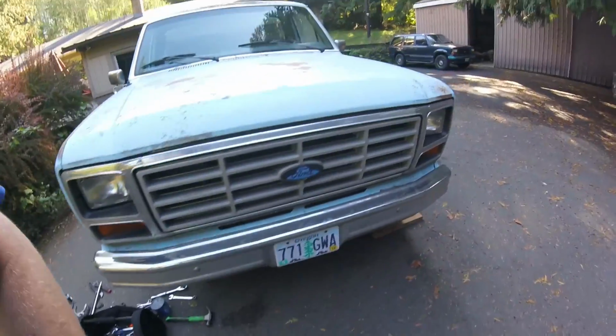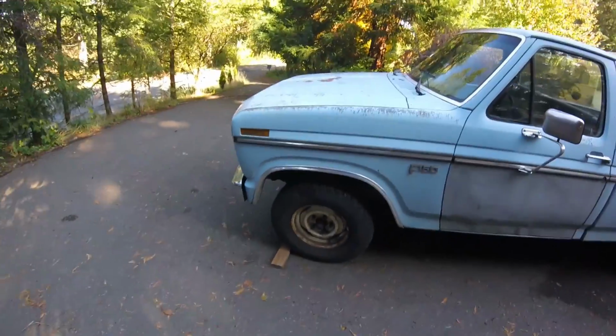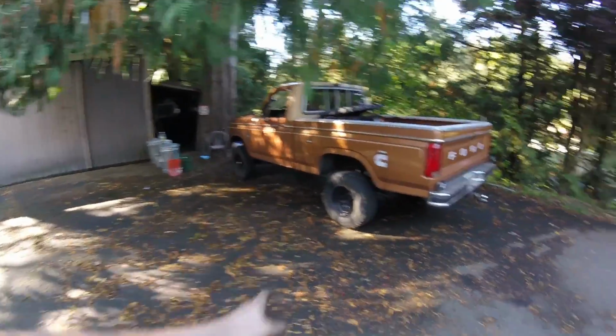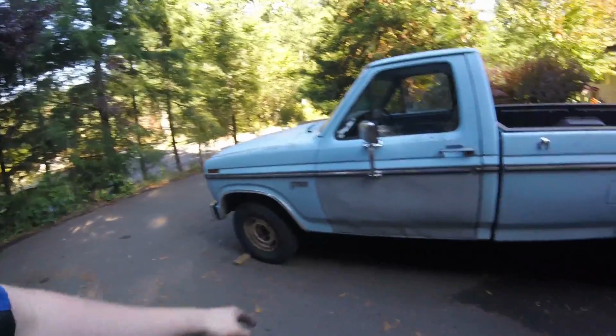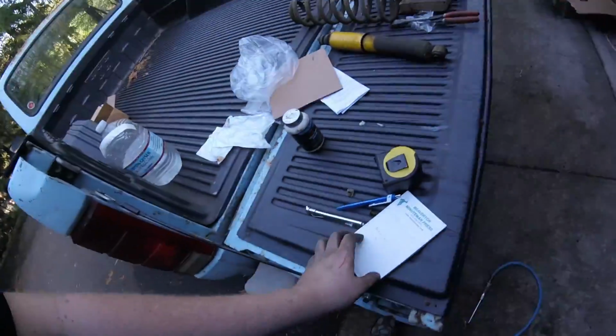I don't know how much the steering alignment is going to be affected as far as toe goes, because I don't know how much it's going to lift. Because when I put those springs in, I had the 4BT, and remember they came out of this truck, so it sat just about level, and then the wheels were all like this, and I jacked his up to where my truck used to sit, and they didn't camber out that much, which I thought was interesting.